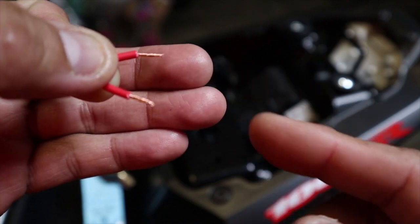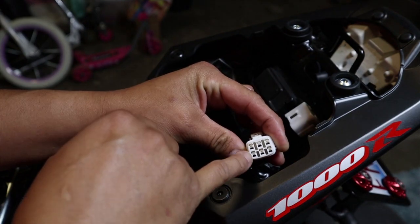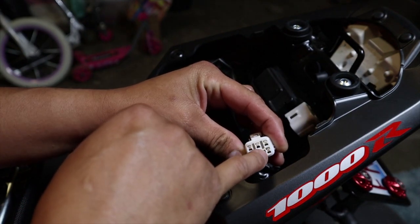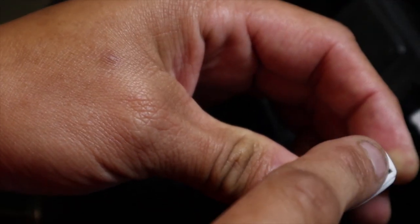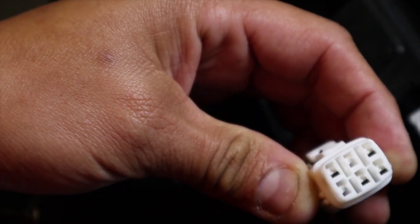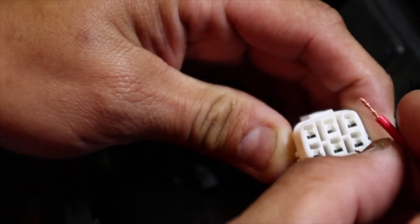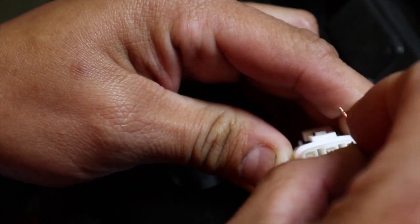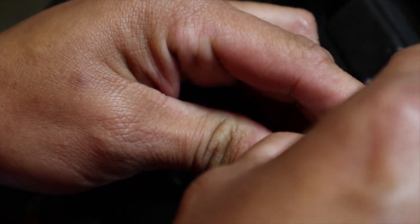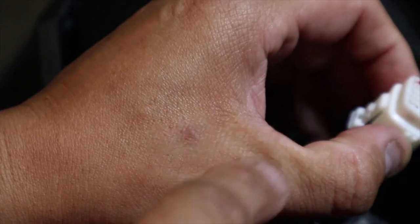What we're going to do is bridge a connection on this plug. When you look at the plug you'll see contact points — one here, one here, and then these two right there. We need to bridge this contact and this contact together, and that's where this little cable we just made comes in handy. Stick one end on one terminal and pop the other end into the other terminal — pretty much looks like that, and that's all you need to do for this part.